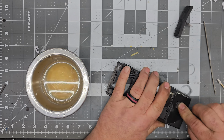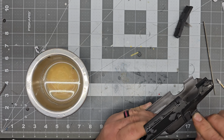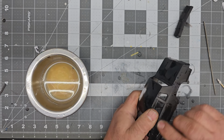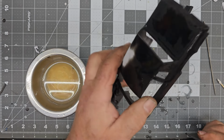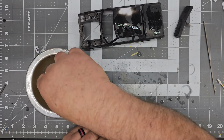Not always. I mean, you could layer the paint on pretty decent. Give it a little wet sand and away you go. Now you see just that little bit I'm hitting right there, see it goes through. I don't have the primer on very thick. So we're basically just taking this, just cutting it down, just taking a little bit of high spots off of it. Okay, and that's going to be good enough for that. Like I say, we don't have to get carried away with it.